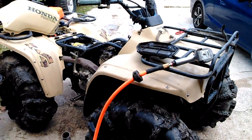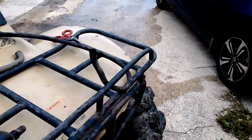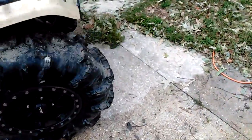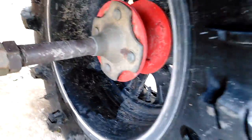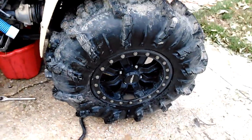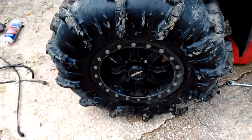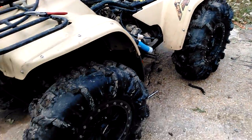All right, a few more Honda 300 Pro tips. I've been doing some testing, and one thing I've noticed is it's really important to keep your rear wheel track at least as wide as your front. So I've got these nice 3-inch steel wheel spacers in there, which is what you need. If you're running IRS wheels all the way around, you need 3-inch in the back. 2 inches is what I had, definitely not enough. 2.5 is close, but no, you really need 3. So got those bad boys on there, good to go.